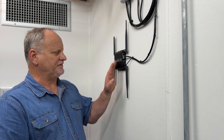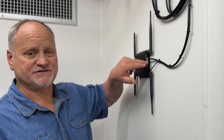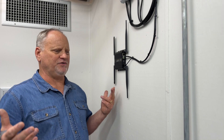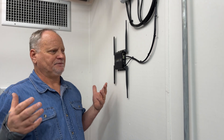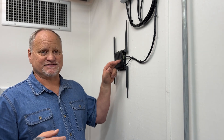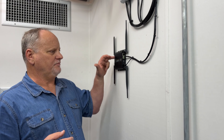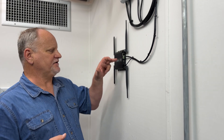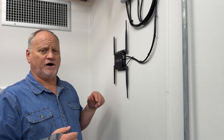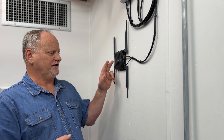Another neat feature is you can hook in an additional WAN connection right here. So if you have your cable company or phone company service coming into the router, you feed that out into this unit — allowing it to switch between connections. There are three entry points, so if one fails, it switches on. You can configure all of this in the GUI, telling it exactly how you want things backed up so you never lose service. That's what's really nice about the CradlePoint.